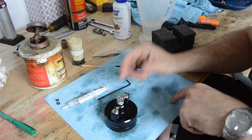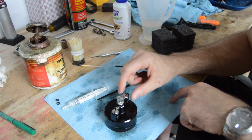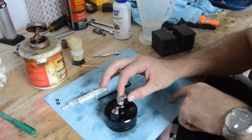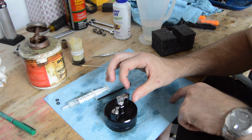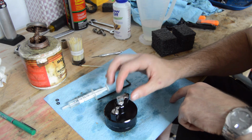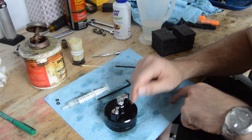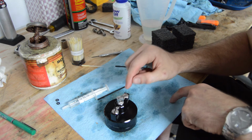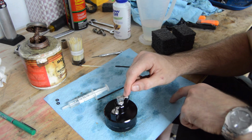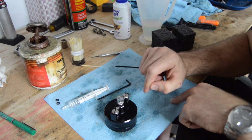Then choose one adjustment screw, either one, doesn't matter which one. Back it all the way out until it stops at the mechanical stop. Wait another 5 seconds. And then from there, we rotate the screw until we feel a little bit of back pressure in the screw. So we're going to feel a little bit of resistance as the screw starts to go down because pressure will build inside of the damper. From that point, the screw should be within 1/4 to 1 full turn of bottoming out on its thread.